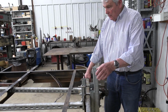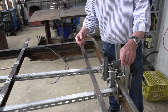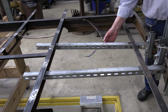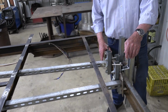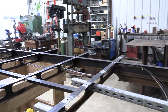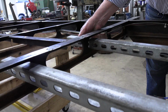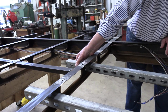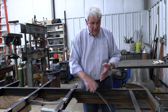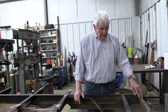So going back to my hot rodding and drag racing days, I created here what is referred to as a slapper bar, meaning that when this tries to bend, the force is immediately transferred up into where I have these in. It's almost a tight fit naturally, and it remains rigid. That was to avoid bending the bumper.